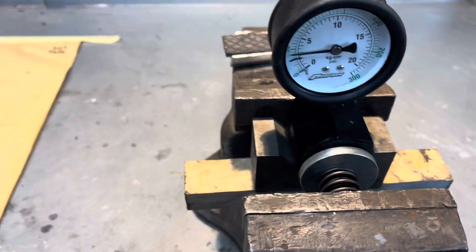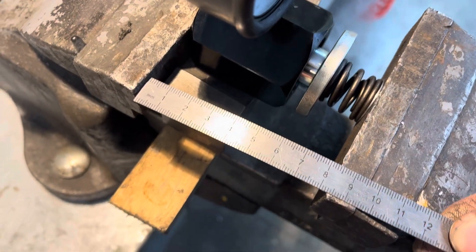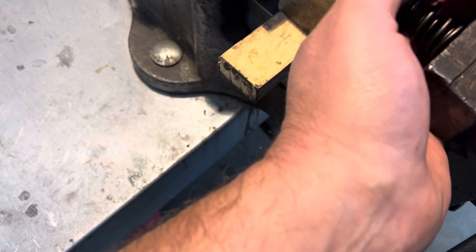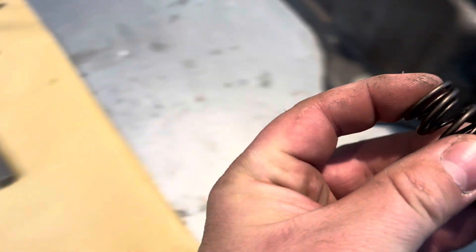There's a stock one. They're just on 40 PSI — they are 40 PSI at 83mm. It's only a bit of a Heath-Robinson setup; we have a proper jig for doing this normally when we're testing bundles of springs. So I will now install the 1.9mm shim.